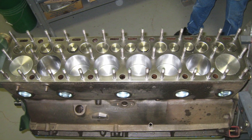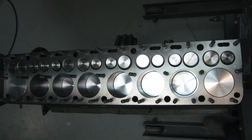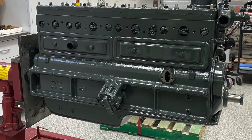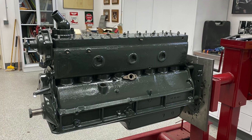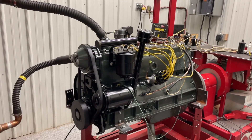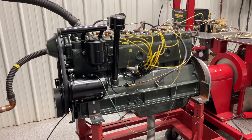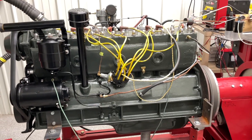We use Arias Pistons, which is now CP Carrillo — that's what's in this engine. They really work well; we've been using them for 35 years or so. Something really nice about this Packard design is that it has an external oil pump, so if you have any problems with the oil pump, there it is — it's a really smart idea. It's a normal one-piece cast-in-block L-head design, two valves per cylinder — pretty standard stuff, but it really works well.